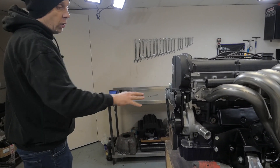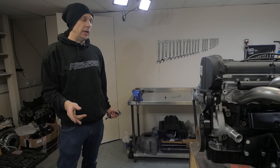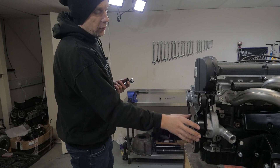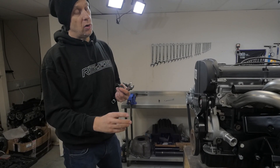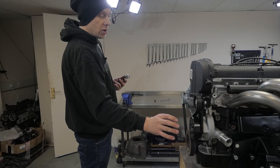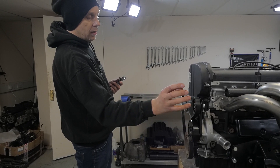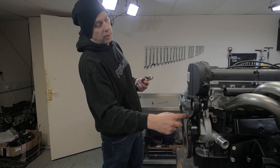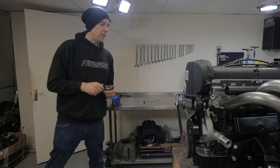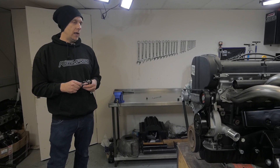That's the 70-amp alternator fitted — it will run pretty much anything from a rally car with a heated screen. On the water pump: there is only one water pump you can buy for a blacktop; there isn't a reverse-impeller OE version, so if you have a blacktop with the correct water pump there's no need for a reverse-impeller pump. This pulley setup takes care of running the belt in the correct rotation. Don't forget to like, subscribe and share our videos — we'll be back again soon.